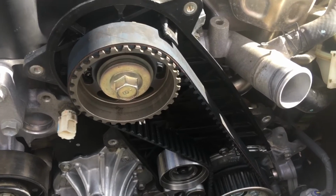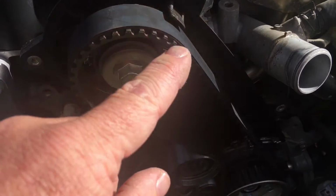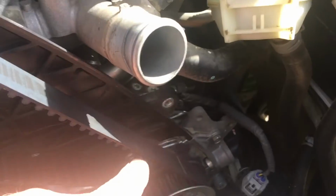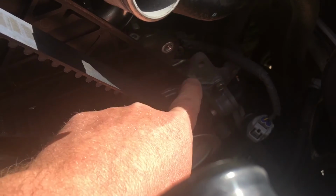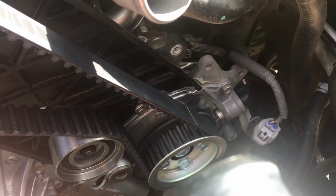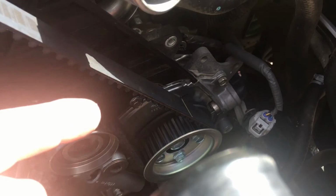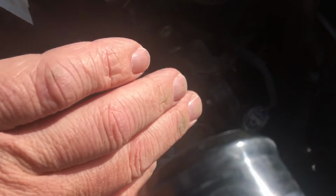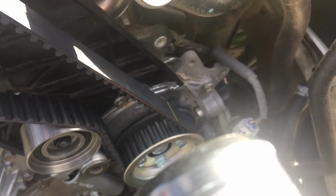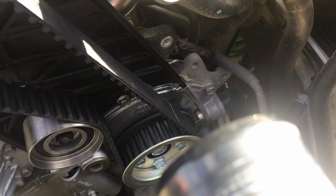Anyway, so, bit of dust there. We're going to blow that off. So the backing plate goes back on. When we put it back on, there's already some sealant at the bottom there. I don't clean that off because it's really neat, the job they've done at OE factory. So I just put a really light smear on the back of the bottom of that plastic, using the same grey RTV that glues that cover, and it's really good doing it that way. And you can see the nuts and bolts that hold that cover there.